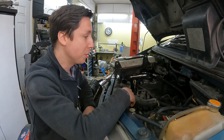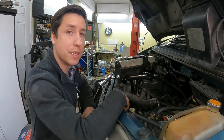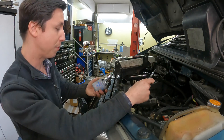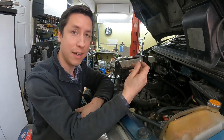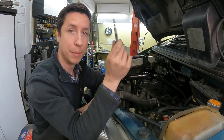We've confirmed that all of our glow plugs are working as they should, and we have power to the whole system. That means our hard start probably isn't going to be the glow plug, so we're going to have to dig a little bit deeper to see why this vehicle is smoking on cold starts. In the meantime, we're going to throw these back in. Be careful — if you did the glow test, they might be a little bit warm, so don't touch the end. Before we put them in, apply some anti-seize. If these things get stuck in the cylinder head and you snap one off, it is a nightmare to get them out — you sometimes have to resort to pulling the whole cylinder head off, or even replacing it. We've got our glow plugs all back in. If you had found a bad one or replaced all of them, just throw your bus bar back on, reinstall your intercooler, and you're good to go. Because we didn't find any issues, we've got to start digging deeper into the fuel injection system. Hit that like and subscribe, and we'll see you next time when we get into the injectors.